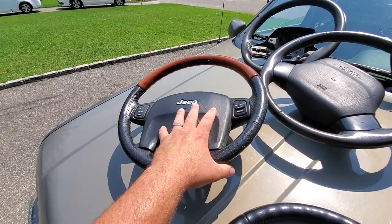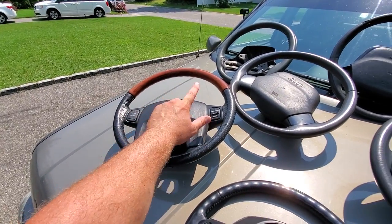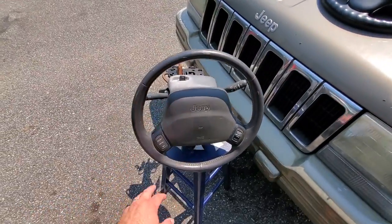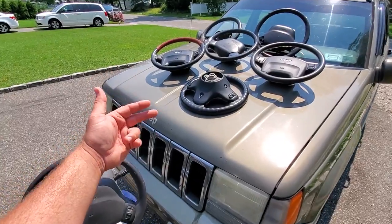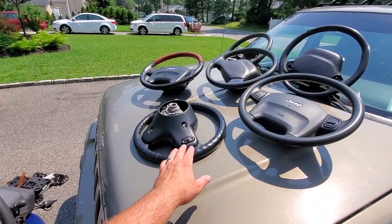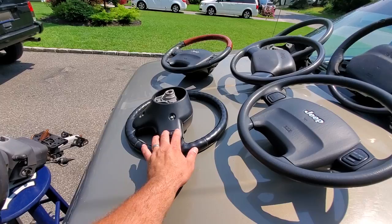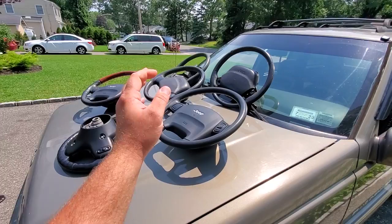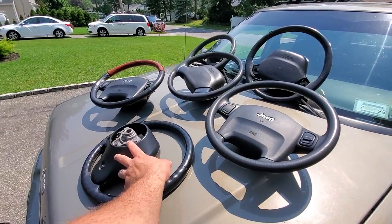That Overland steering wheel is going to be implemented in Beach Jeep eventually, but my wife doesn't want it. We're probably going to use this one with those radio control buttons. This is an XJ steering wheel with cruise control buttons. XJs did not have radio controls behind the steering wheel like this, but actually you could do this to any Jeep. If you want, you can add steering wheel control buttons — you just need a steering wheel with buttons for the radio, a clock spring with the wires, and a SWIRC adapter. We'll get into that later.